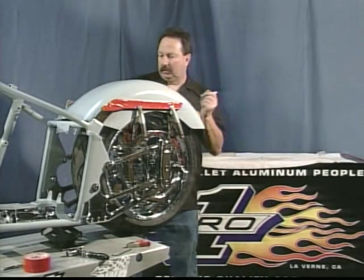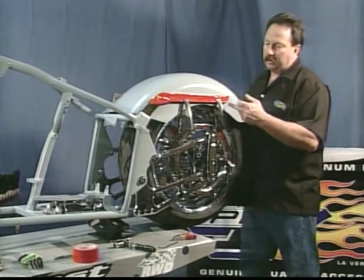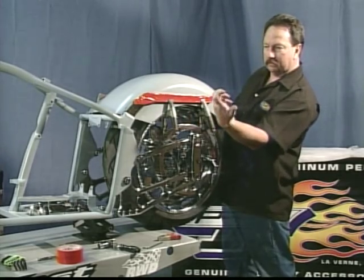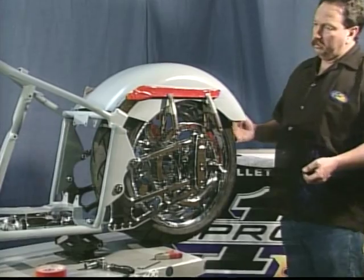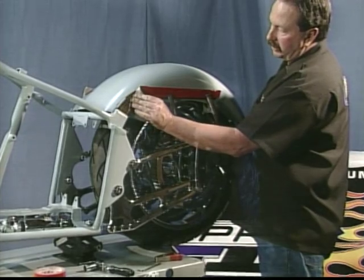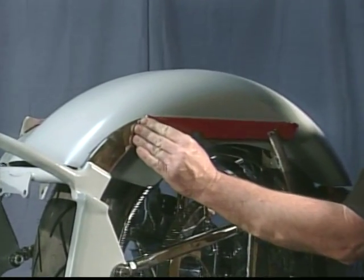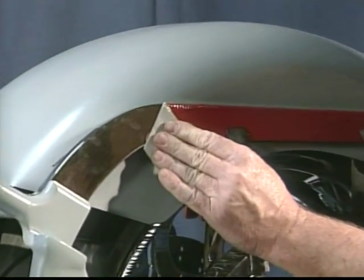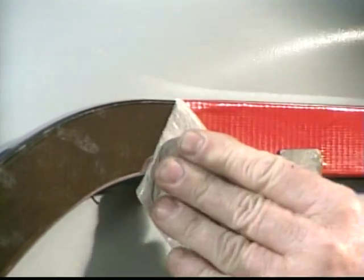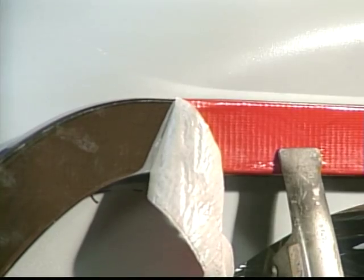I do the same thing and trace it as tight as possible. That's important — get a nice sharp Sharpie and get in there as tight and as far up as you can. Now I have both sides clamped. That's not to say the fender's not out of square. Another little trick: I already know where the bubble is on the frame, so I'll take and put the level underneath this fender — not all the backs are cut straight so you have to be careful. This fender looks very close to what the rest of the bike is set at. I'd back up 10 to 15 feet and sight the fender for level and square going right up the middle of the chassis, because it will show up bad when the whole bike is built and painted if this fender is put on crooked.